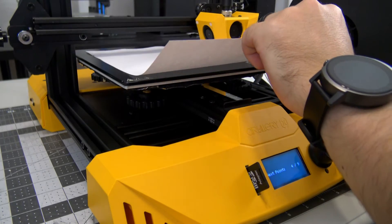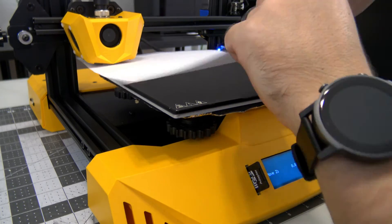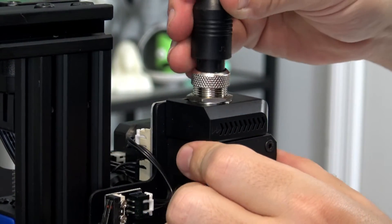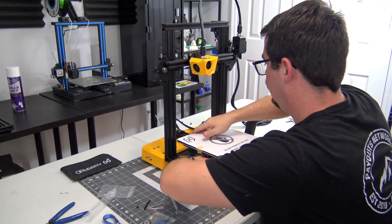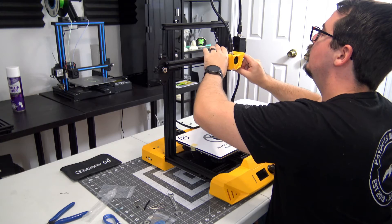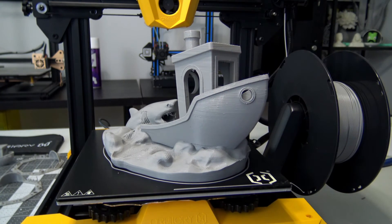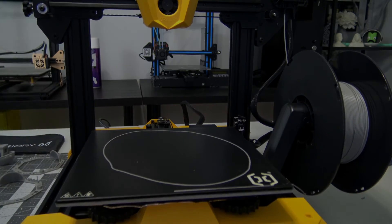To help keep costs low, the Artillery Hornet is missing some features found in other Artillery printers. There is no power loss recovery, nor filament run-out sensors. And while manual bed leveling was easy and I haven't had to adjust it since initial setup, the integrated cable would make it difficult to add an automatic bed leveling probe to the hotend. The integrated cable gives a clean appearance, but it would make repairs or replacement of wires or the PTFE tube difficult. The integrated tube also makes cold-pulling the filament to clean the nozzle more difficult. If you are the tinkering type, the clean design of the Hornet might make it harder to modify down the road. The glass print bed is also permanently attached to the heater — not being able to remove the glass makes it harder to clean, and you'd have to replace the entire bed if you damage the surface.